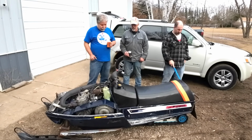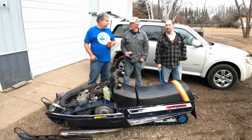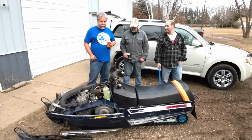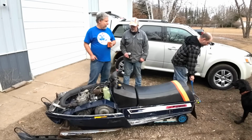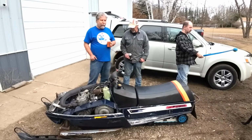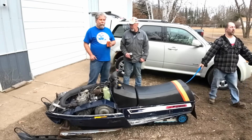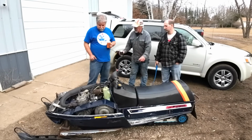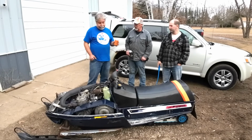Yeah. And I'm thinking the track, well, we certainly weren't on the limiter strap, so that's not the issue. But as far as the track suspension goes, the skid, there's one more set of bolt holes above the ones it's in, and we might move it up there just to give it some more ski pressure. Maybe try carbides first. Yeah. We know carbides are going to make a world of difference in making it turn. And we never really checked to see if the whole front suspension works properly. We've just been dealing with the motor and the rear suspension, so the front might be bound up.